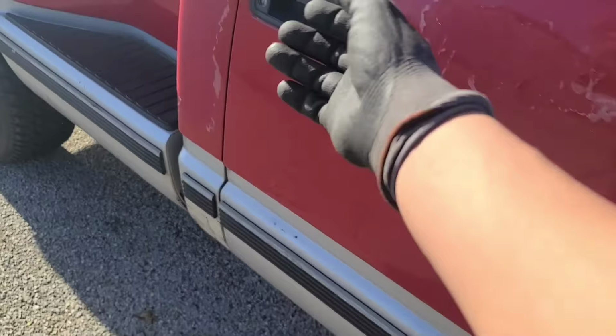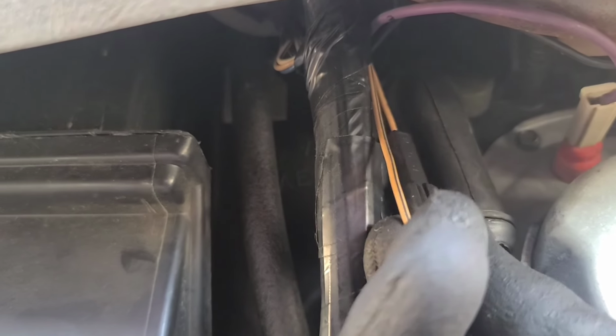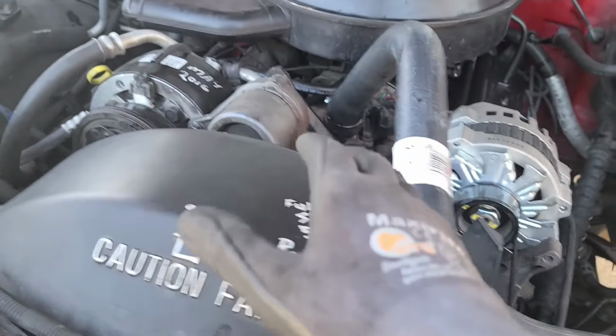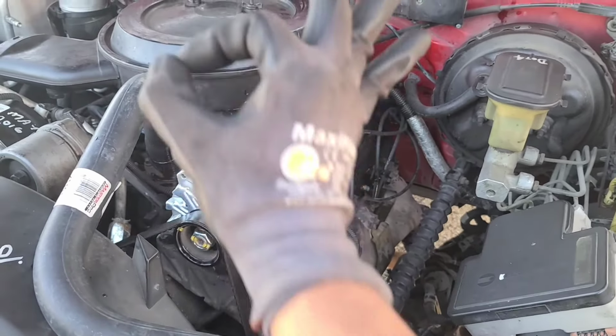Then before you go ahead and start it, and before you start adjusting your timing, this guy right here, you've got to unplug that. This is what I guess controls, advances or retards the timing based on what load condition or whatever you're doing to the car. With that disconnected, have your timing light hooked up, and these on the 350 TBIs are set to 0 degrees.